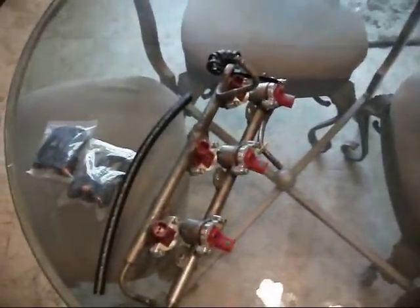These are all the clips that we've got to solder on. We've got to solder the new clips on because the new injectors are oval instead of squared. The squared ones always corrode, but the oval ones do not. But anyway, let me bring you out here to the garage.